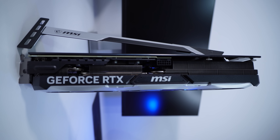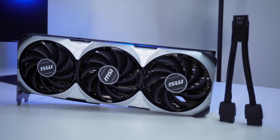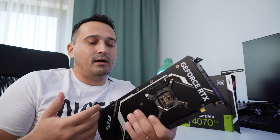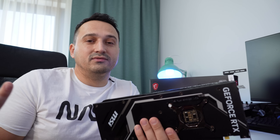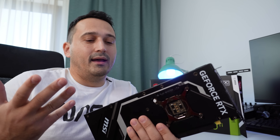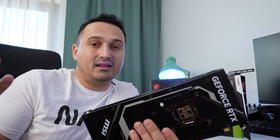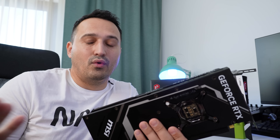This is not a very high power-drawing GPU — it's only rated at 285 watts, which is plenty if you're planning to use a normal GPU with two 8-pin connectors. You're getting the 12-pin connector here, the same one used for the 4090, which is the beast. This card is drawing just half that power, so it's more than safe to use with your 4070 Ti.